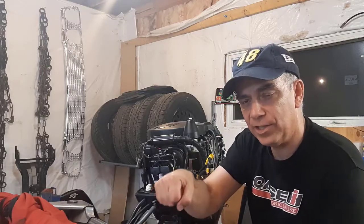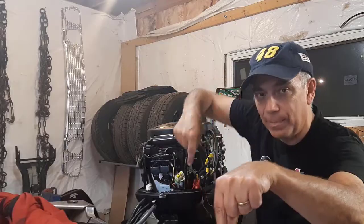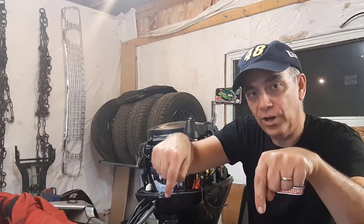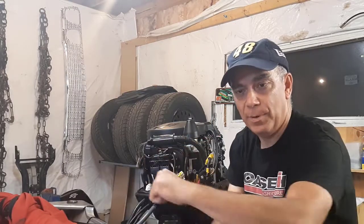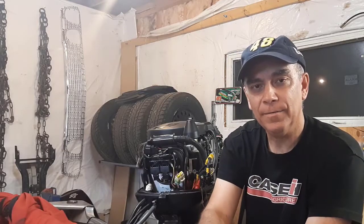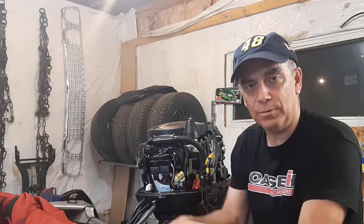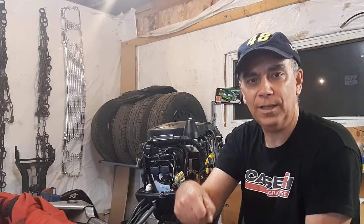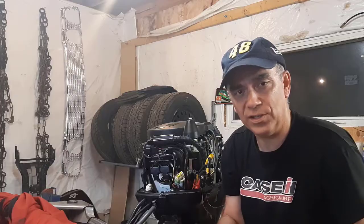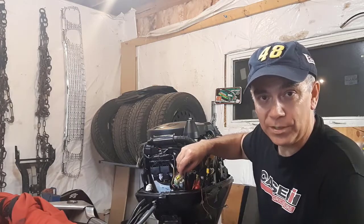The reason I did that was because the battery posts were facing the back of the boat — the transom. I know the positive cable goes to the right and the negative to the left, but when I put the battery in I had turned it around and I wasn't paying attention.